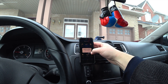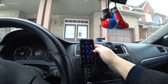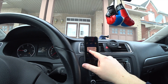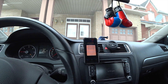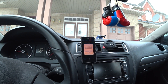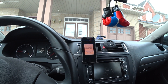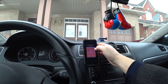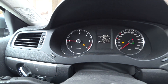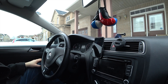Freeze frame is another interesting report. If you want to clear codes, you can click 'Clear Codes.' It will tell you that you should clear codes only once you've fixed the problem. I'm going to try to clear all codes and you'll see it's clearing here — we're going to see if my engine light disappears.